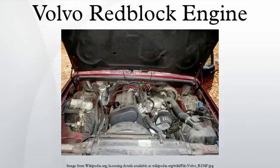Exhaust valves were sodium filled for cooler operation. The engine has smaller valves and stiffer valve springs than the naturally aspirated 16V. Crank torque is 219 Nm at 2950 rpm for the GT, and 218 Nm for the FT. Other differences from the normal 16V Red Block engine are that it uses a remote-mounted oil filter and a windage tray.